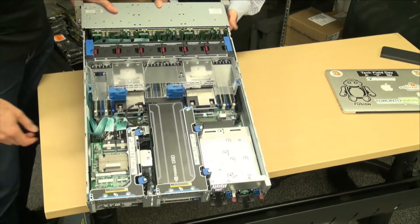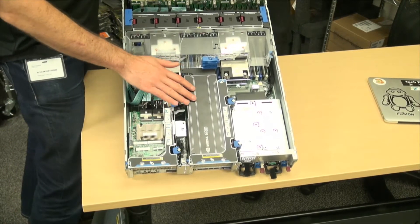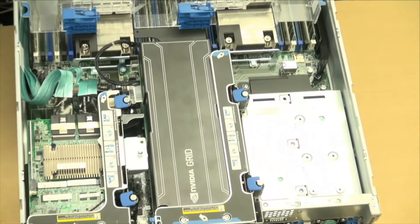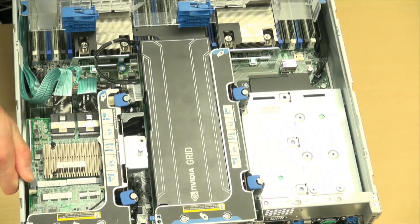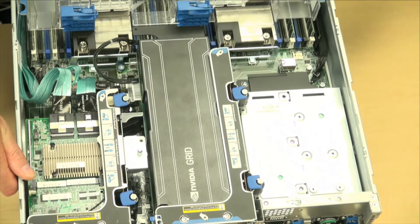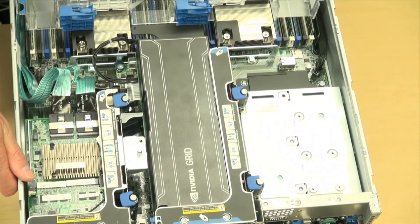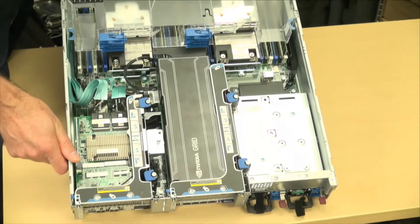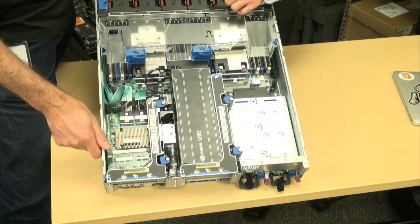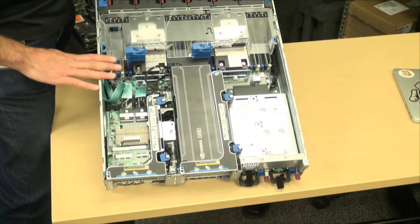One of the things that immediately strikes me is this NVIDIA GRID card — I'd quite like to take one of those home, but I don't imagine I'm allowed. Why have we got that one? This particular configuration is for VDI, so they have graphics cards installed. We also have a 10-gig network card and a RAID controller to connect the different drive blocks up front. This is a dual-CPU unit — we can see the memory DIMMs in between the CPUs and on the edges, with sheathing to help with airflow. The fans are at the top and these red tabs mean they are hot-pluggable. In this particular model, only about a third of the DIMM slots have been populated.